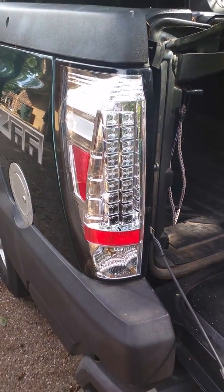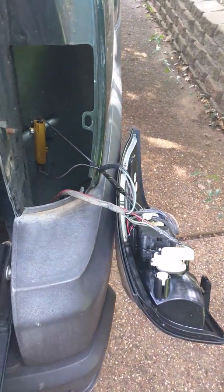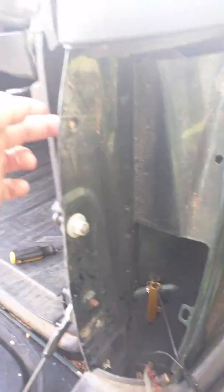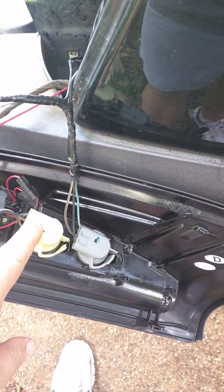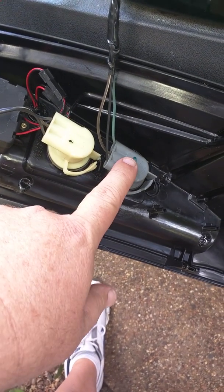And finally, there's the offending pair of LED tail lights. They look great, and they've got a lot of internal electronics. You would think that they would have put some resistors in to solve some of the issues, but I don't think they did. This is the right side unit, which is the one the cruise control actually looks at — specifically the right side brake wire. So once you pull the unit out, screws are here and here. The Avalanche is a little bit unique — in the earlier years you actually had two tail lights: one was for the turn signal and one was for the brakes. So this lower one is actually for the turn signals, and this one is the one that is for the brakes.